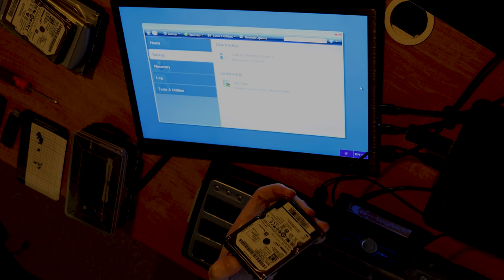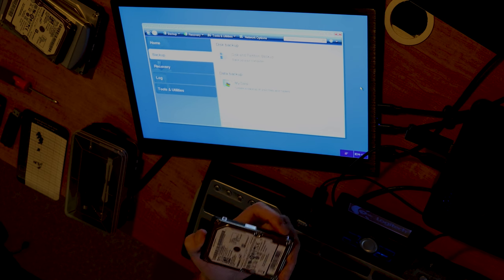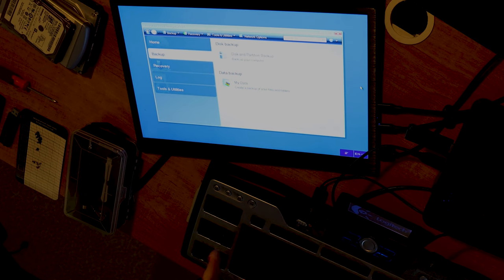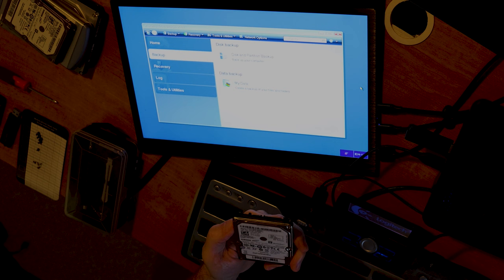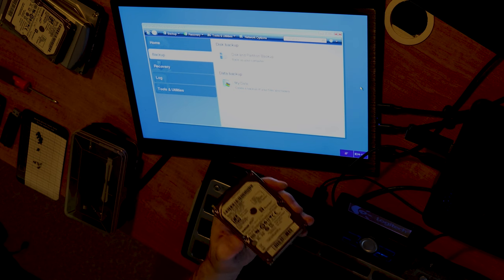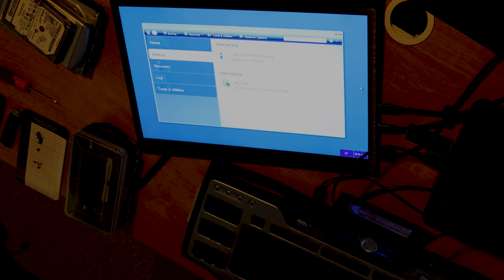And when I used the Ubuntu, I was able to mount the drive and look at what was on it. It was a Windows install. So I know that, and then I rebooted into it and it said it was Windows 7, but it froze. It couldn't load a driver that it needed. So it hung on the boot, which is perfectly fine. I'm going to wipe this anyways. So we will get this reconfigured here and we'll be back in a minute.